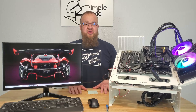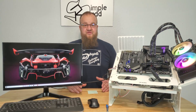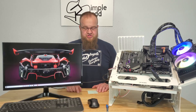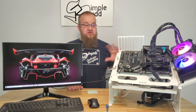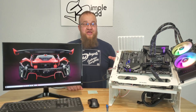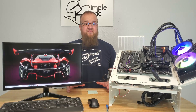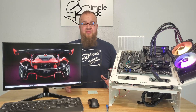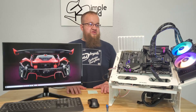The max temperature was 87°C, with one core briefly hitting 89°C, but the package average max was 87°C with most cores hitting 85–86°C. These temperatures are with the processor running at 175 watts, maintaining 5.1 GHz — it never thermal throttled. I ran Cinebench two or three times to verify results, and also ran Prime 95, though Cinebench actually stressed it more.